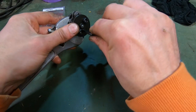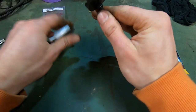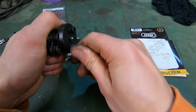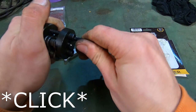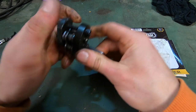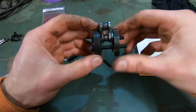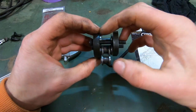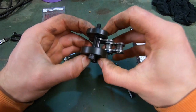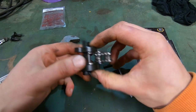Then you just do these up — I think it's a quarter turn at a time, roughly. It does show you on the back exactly how much. Just do them up gradually. You could hear then that it actually went through the hole even though I haven't got a full pin on there — you heard it go clink. What happens is there'll be an O-ring and stuff in there, but it basically pulls the plate in so it's even with the next one. You do it up until the next chain link's touching and then you know you've pulled in the right amount.